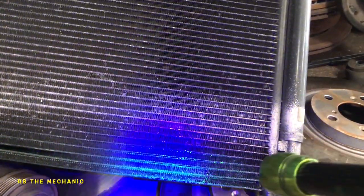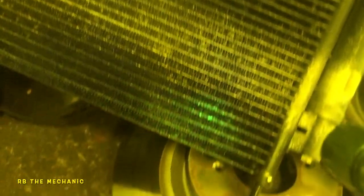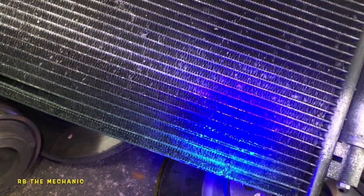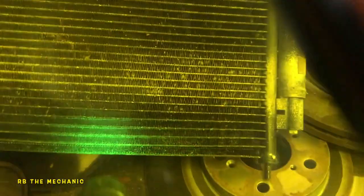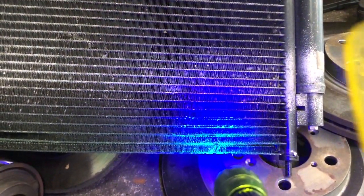Here's a condenser I changed before — with the light alone you won't see much, but if you put the glass in front of the camera it works really well. You're able to track the leak down. My shop light is on so we're not going to see a lot, but with the UV light it works. Let's take off the glasses — you might see something but usually you need a large buildup. That's the difference: with the glasses versus without the glasses.